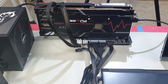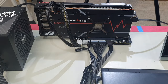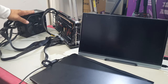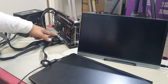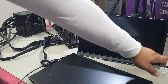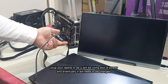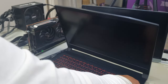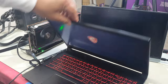Connect an HDMI cable from the external monitor to the HDMI port on the graphics card — not the laptop — since we're using the eGPU's output. You should see a green light indicating monitor power. Double check all connections: 24-pin and 4-pin CPU into the enclosure, 8-pin GPU power output to the graphics card, HDMI to the GPU, and power to both the PSU and the laptop. Then press the power button.